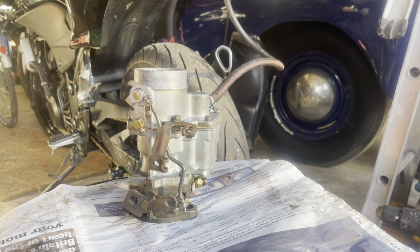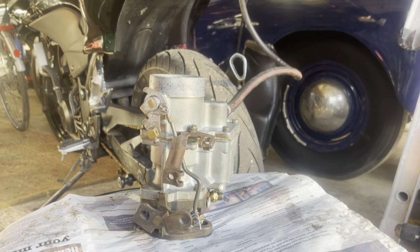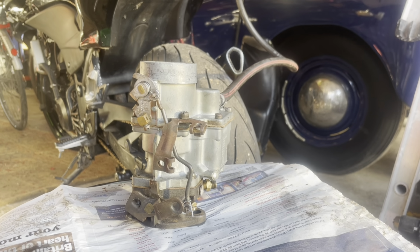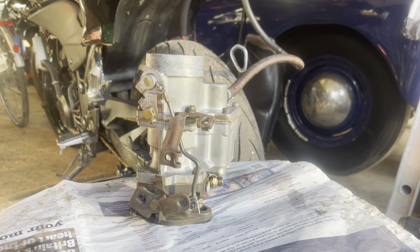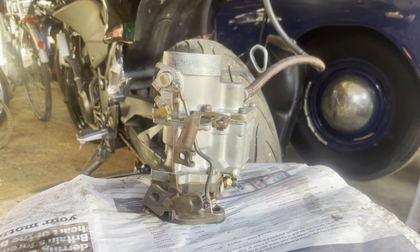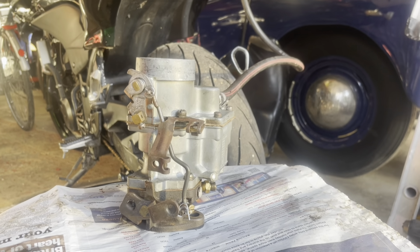I've been a motorcycle mechanic for years, but I've never really worked on cars like this. So that's telling me that because I've had it in pieces, they just stuck that little bit. Sometimes it happens with motorbikes, they just stick. When you put them back together, they just stick a bit. You just literally need to tap them a bit and then they sort themselves out. They've just somehow got the tiniest bit lodged, and then they're right and they're great for ages. So that's good news. I'm thinking it doesn't actually leak. It was just the float. So really what I should have done is just tap the carb. But never mind. Let's get it back on again.